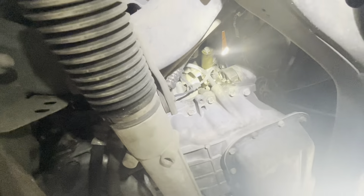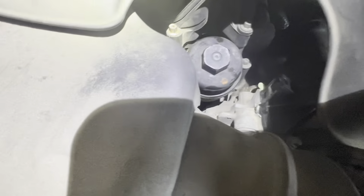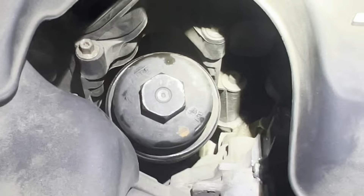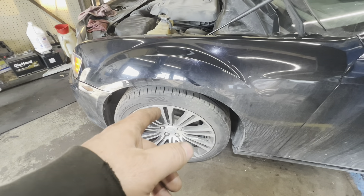There's a drip coming off the bottom of the alternator — that might be from the valve cover coming down. I'll take a better look up top. The engine oil cooler housing is leaking a little bit with some puddles of oil down in there, but it's not pouring off the back of the bell housing yet. The valve cover is actually dry, so I'm going to call that the timing cover leaking a little bit. The only play I've seen in the front end was the upper control arm ball joint — it had a little play in it.